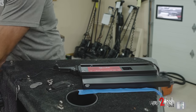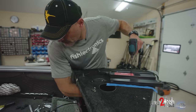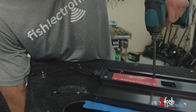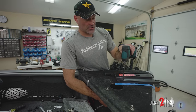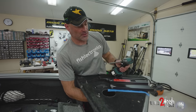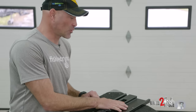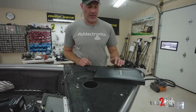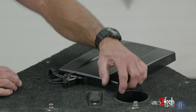With our fasteners through the base plate, the next step is to take our washers and nylocks and get everything started underneath the bow of the boat. Then we take our 7/16 box end wrench and snug everything up. I like to use an impact — you can tell when the fastener is tight. I would not recommend just putting a tip into a drill as you have a tendency to strip the screw head. With the motor off the base plate, you'll notice sharp edges — that's where the cover comes in. Set the cover on, flip the lever, put the safety pin in, and all those sharp edges are covered up.